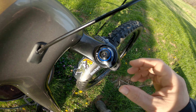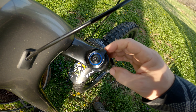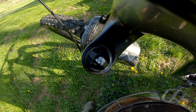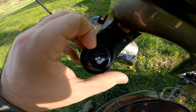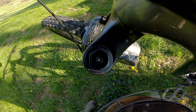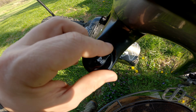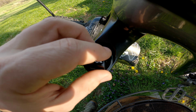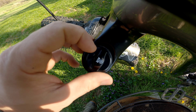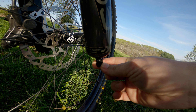The 35 Gold has compression damping with five clicks of compression, and when you go all the way back it locks the fork out. This is where you add the air to the fork. It says it has a Debonair spring depending on who you buy it from, but it's more like the Solo Air spring, and the inside diameter of the stanchions is actually closer to 32 millimeters. So if you need to use bottomless tokens on this fork, you'll use the 32 millimeter black bottomless tokens — that will make it much harder for your fork to bottom out. The rebound damper has about 14 clicks of adjustment.